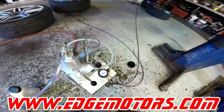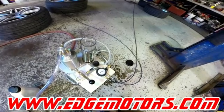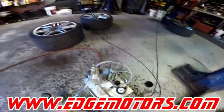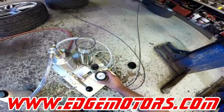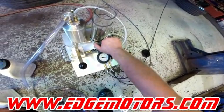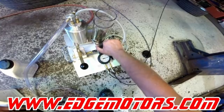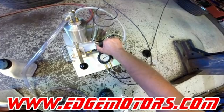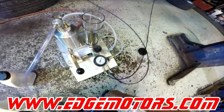Yep, it's right there at 22 bar. Let it sit for a couple of minutes and then let some pressure out. Alright, so we had it sitting for about 5 minutes. Now we're gonna release the pressure until it's around 16 bar — open the needle valve and drop some of that pressure. That's it. The charging of the DRC system is complete. Now we can disconnect the lines.